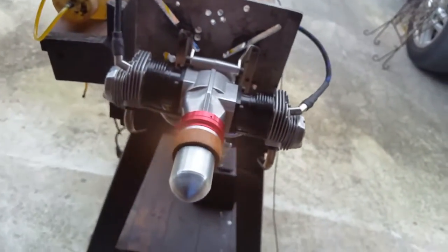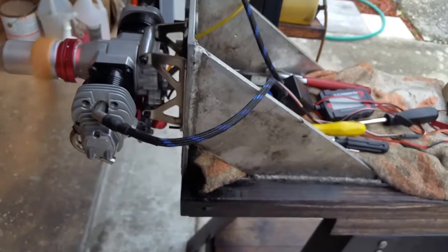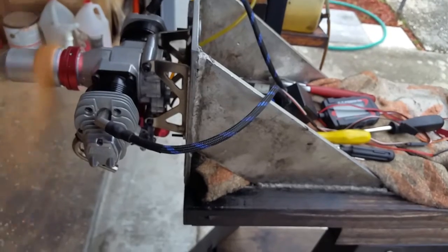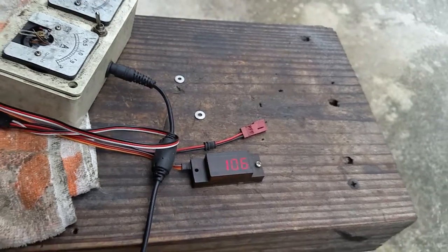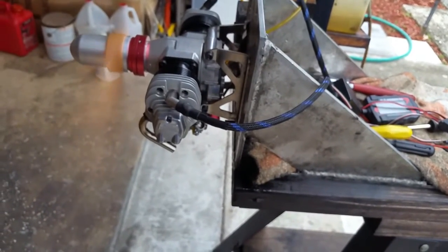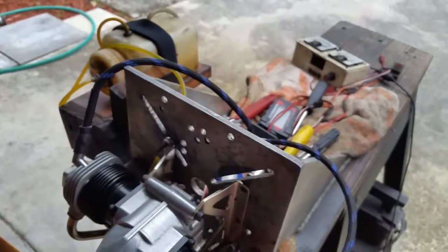The idle is really low — I'm surprised it started like this. Let's let it warm up a little bit. One thing that's gonna happen when idling this slow is it's going to go into a rich condition and run a little rough, but I think it'll get over it quickly. I know yesterday it was pretty good. The best RPM for reliability will be around 1400 to 1600.